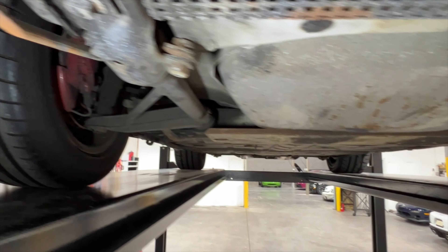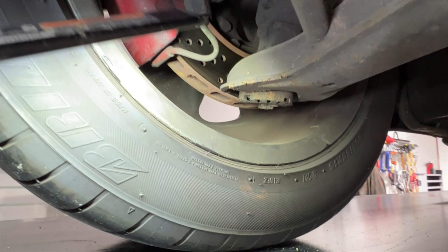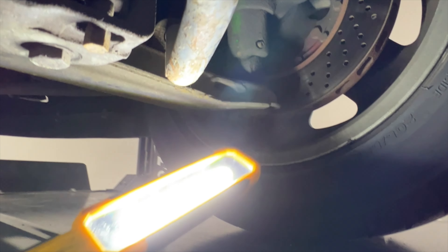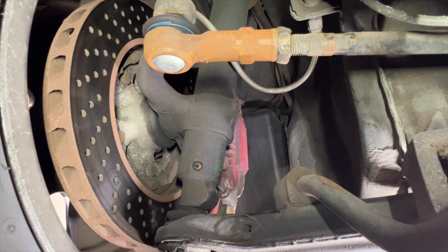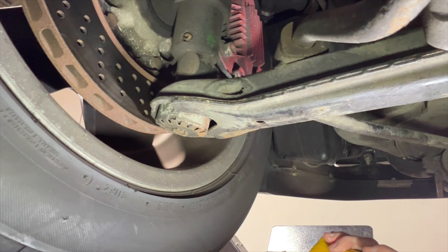Tell me what we've got to be looking for. No idea — so we need to figure out why it's leaking. We'll do a visual inspection starting at the very front of the car. Right out of the gate there's rust — not end of the world. This is the fuel tank; definitely want to be aware if it's rusting through, but you can buy a whole new fuel tank. Right here is the oil cooler — these get rusted a little. I really care about fittings and such, so there's definitely some corrosion. The tow hooks are scraped because it spent its time in California with all their crazy dips.